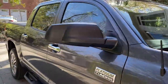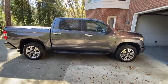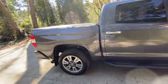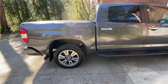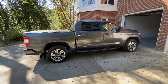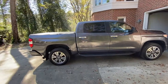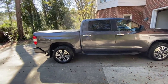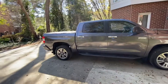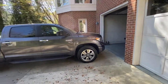That covers the bulk of the modifications and changes I've made to my vehicle for towing more securely and safely. I know there may be some confusion on how I use the Firestone Ride-Rite airbags coupled with my weight distribution hitch — there are videos saying you should never use airbags and only use the WD hitch, but that's not entirely correct. What you need to do is get your bags set where you need them first. For me, towing a travel trailer between six and seven thousand pounds, it's about 30 PSI on the Ride-Rite airbags to keep my rear end from squatting and have adequate weight distribution back to the front end.